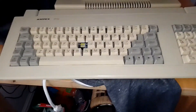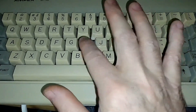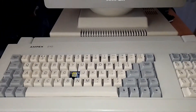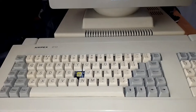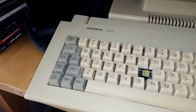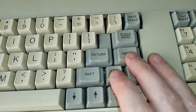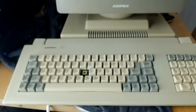That is my terminal with a more or less working keyboard. Shame — I might have to try to glue the key on there somehow. I'd love to buy a replacement keyboard, but that's not going to happen because they cost an absolute fortune. This uses RJ45 connectors which are really hard to find, and I've looked into converting to PS/2 keyboards but that doesn't seem to be much of an option either. There are different protocols in these terminals and keyboards, so even with connectors and adapters I doubt that would work. Also, a lot of these keys don't exist on a PC keyboard — I've got a special Escape key, Line Feed, Break, Delete Character, Setup, Delete Line, and all sorts of things. You really do need a dedicated keyboard for these.